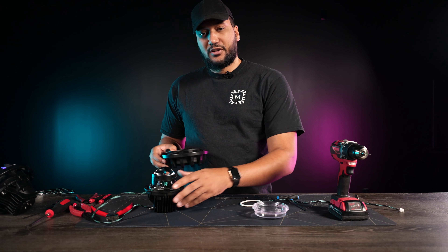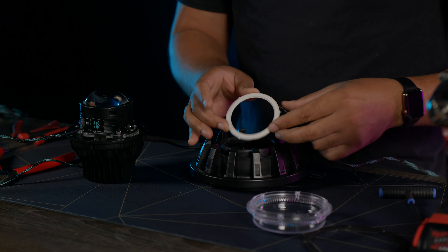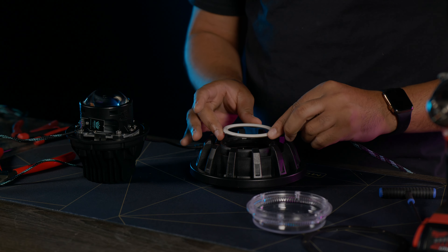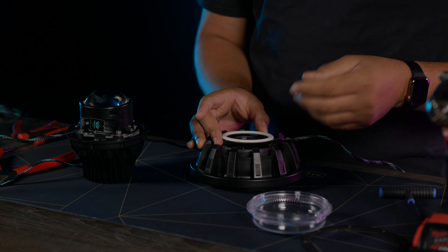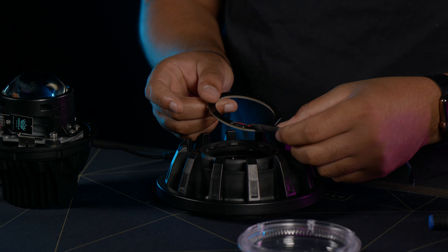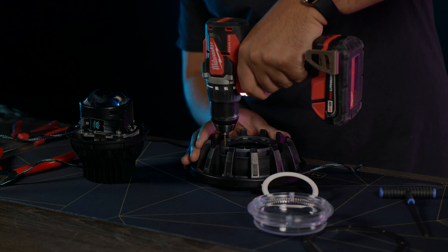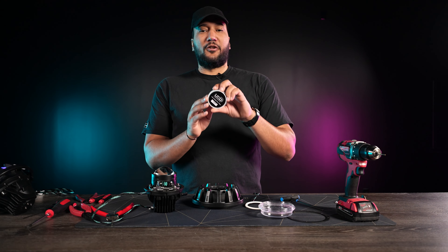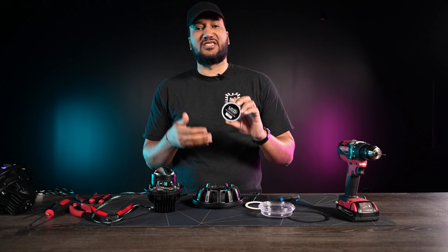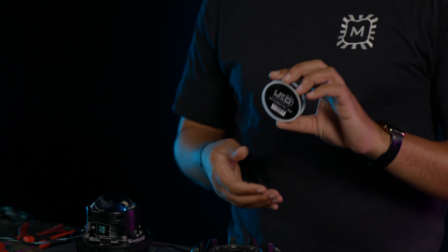We're going to get into the bezel. This is where the fun of retrofitting happens. I'm going to flip this over and put the halo on top of the bezel. What you need to do is place the halo and mark three spots so we can go ahead and drill into it — that way we can have the halo secured onto the bezel itself. Keep in mind it does have a wiring harness, which means more than likely you're going to have to notch out the bezel just a little bit to get this harness through. Go ahead and drill your holes, then secure the halo using halo wire.